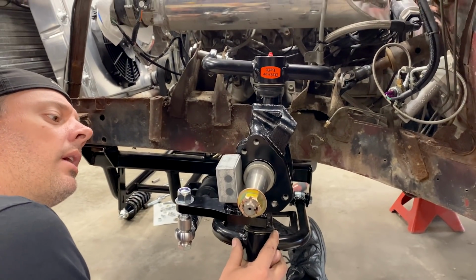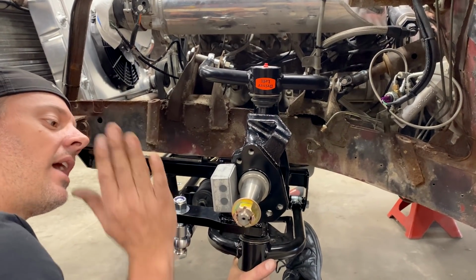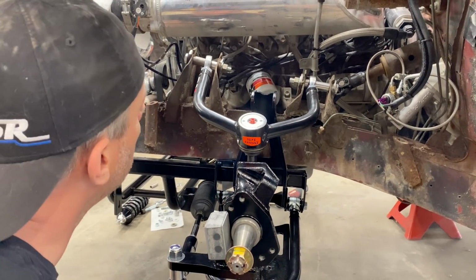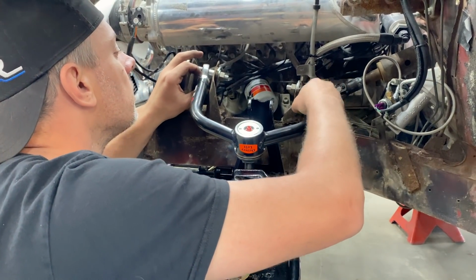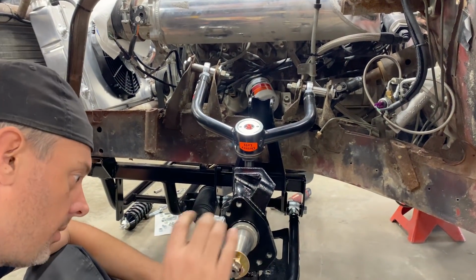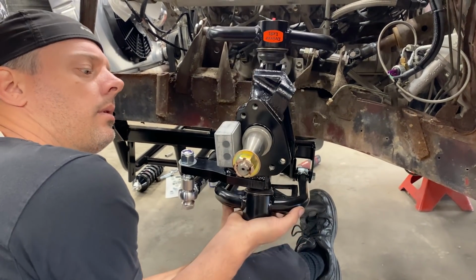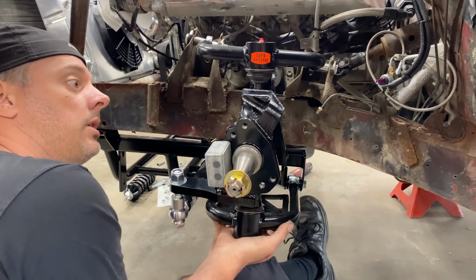Okay, we have camber going the wrong way. Oh, it's going positive? Yeah, it's 5 out at about right height, so that's a lot. We can lengthen the bottom or shorten the top, which we've got a little bit to shorten the top. We are running a 1 inch wheel spacer on here to get the 8 lug wheels on. Yeah, we definitely need to shorten the upper and probably lengthen the lower. Might have to do a little bit of both.